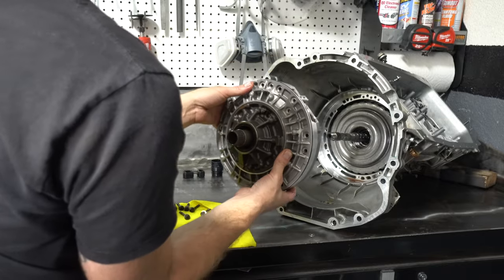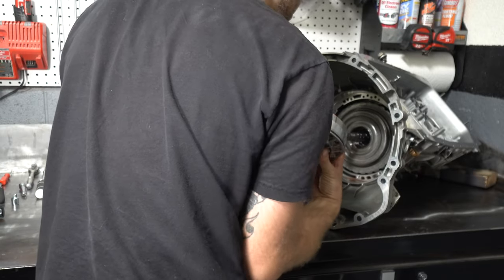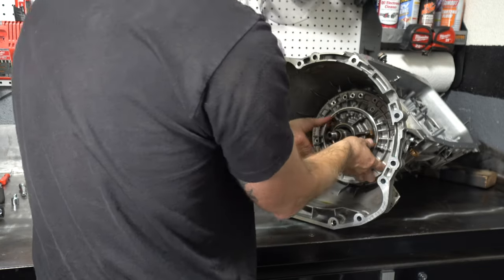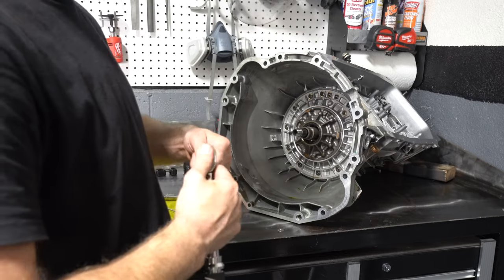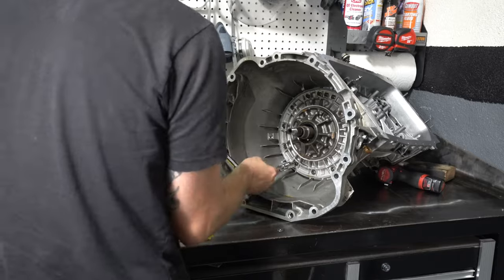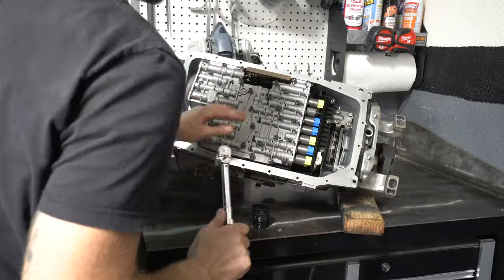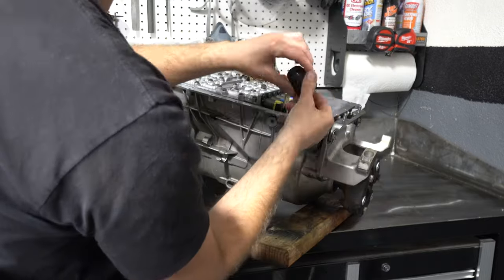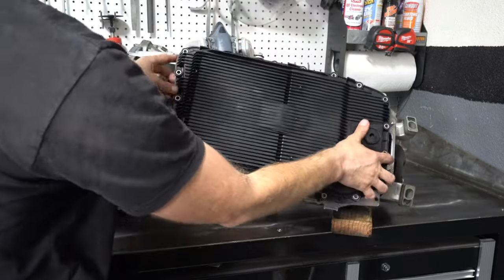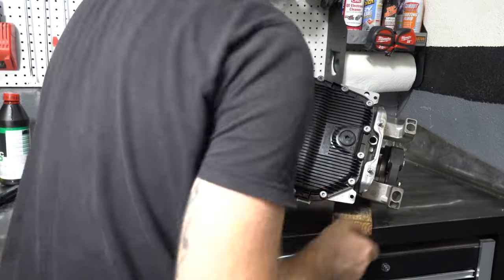This area here is going to go directly into where the valve body sits. I've got the bolts all running — I'm going to torque them to five and then ultimately ten newton meters. Wind the notch up and pop it in. Done.